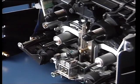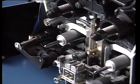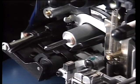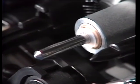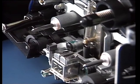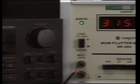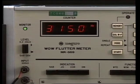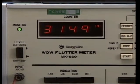After solving the problem of vibrations, we then turn to another very important factor affecting the sound quality of a cassette deck, tape speed constancy. In the CT959's reference master mechanism, we redesigned the capstan with longer pinch rollers to make tape running smoother. The result was a drastic reduction of wow and flutter for specifications far better than those of conventional models.